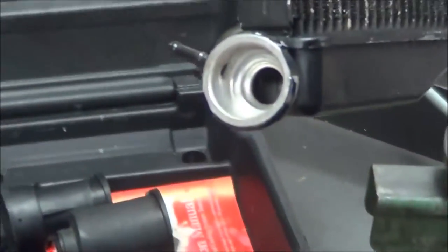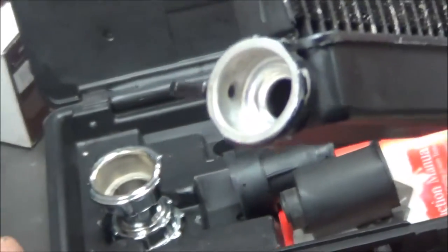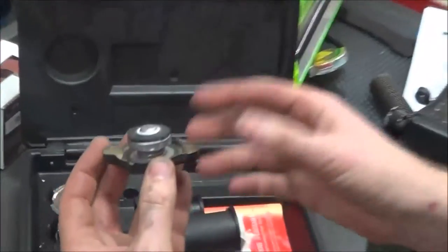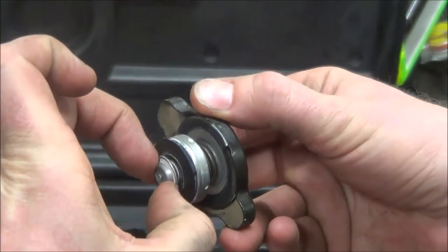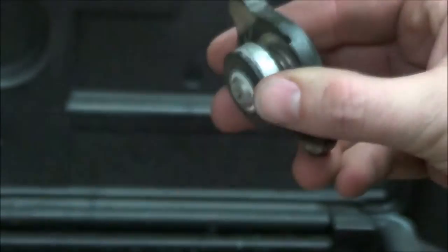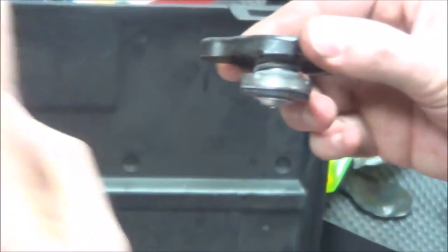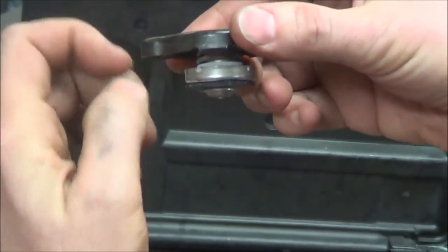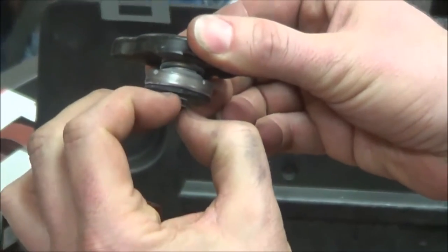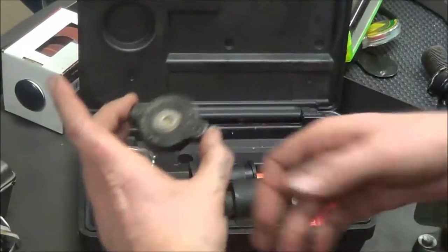You might wonder how the fluid gets back through the sealed cap. Check this out — there's another low-tension spring inside the cap. Under vacuum, when the radiator fluid drops, this spring opens up and allows coolant to come from the reservoir tank and flow into the radiator through this hole right here. That's something that often isn't checked. For the prices these are today, it's pretty cheap to just go ahead and replace the cap.